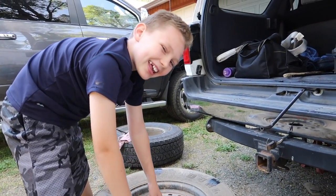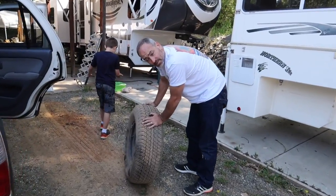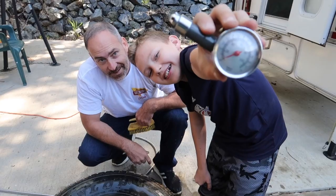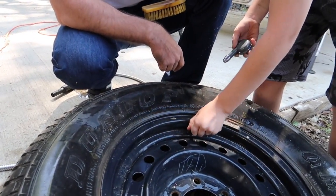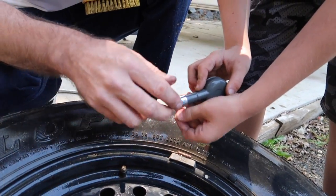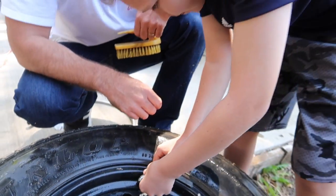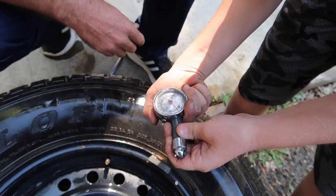You did it, good job. Everything's dirty — we'll just go over here, rinse it off, and then check the air pressure in it. This is the tire pressure gauge right here. Take that off. Counterclockwise to loosen. I just push it straight on — don't push this button here, that resets it. Just push it down, take it off. Looks like 15 — need some air.